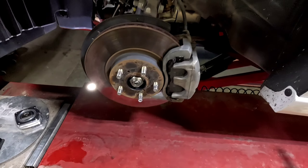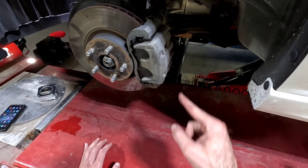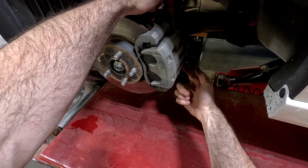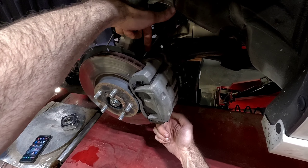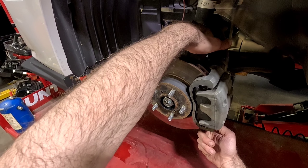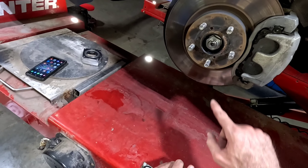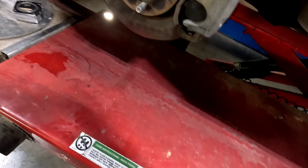While you're here, maybe you want to know how the brake calipers and rotor come off. There are a couple of things you've got to do first: take the caliper off, then remove the bracket. Each caliper is held on by two bolts, and this also applies to the rear caliper — it's just smaller. There are also bolts on the bracket at the very bottom and very top on the back side of the rotor. Once you do that, you'll have access to your rotor. You might find it won't pull off easily — that's where the two threaded holes come in.